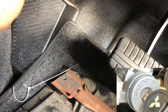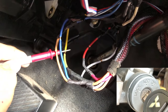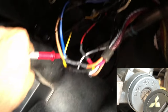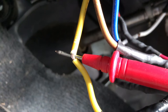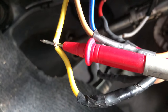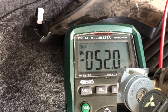Now we can see that the white wire has 12V, as well as the accessory wires. The yellow wire still has no voltage, therefore we can assume that the yellow wire is the start wire. But to make sure, let's test it. Notice that I pierced through the yellow copper wires and passed the positive lead of the multimeter through like a needle and a thread — this makes it easy to show you that this is in fact the start wire whilst holding the camera. There we go — a significant voltage spike when starting the engine.